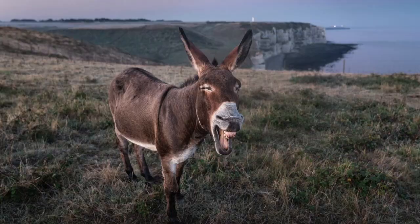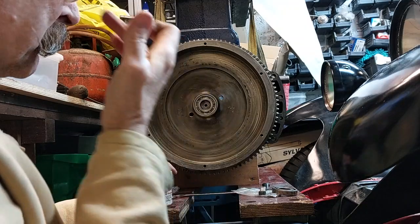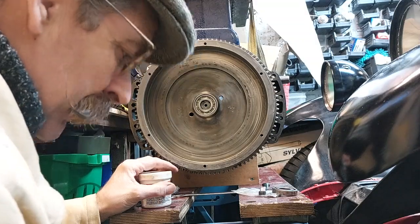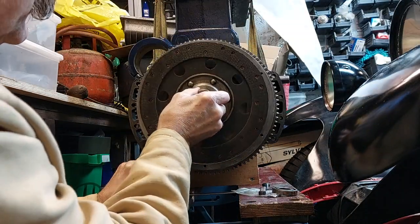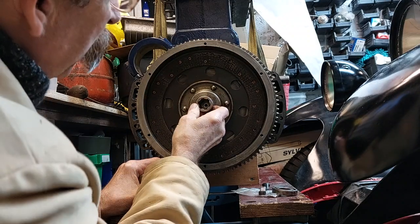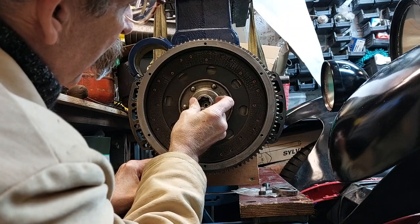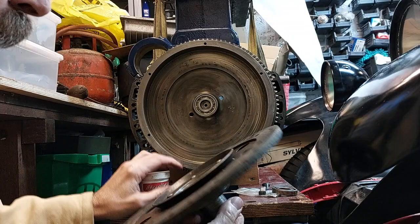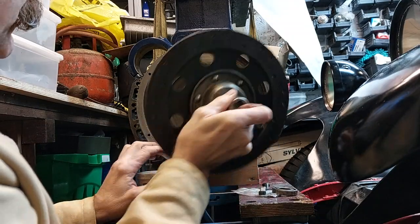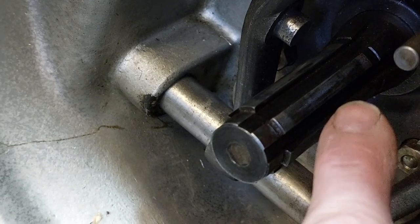Ah, balls. Okay, if you spotted my deliberate mistake there, I didn't check the inside diameter of the clutch splines for the tool, and in our infinite wisdom, Riley have decided that this is bigger than this, so you can't get the tool out if you used it. This is the problem I didn't allow for.